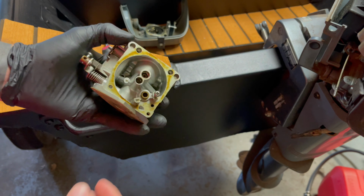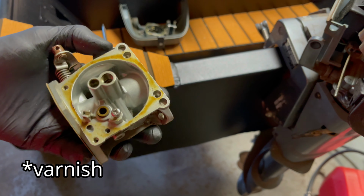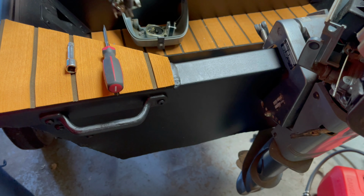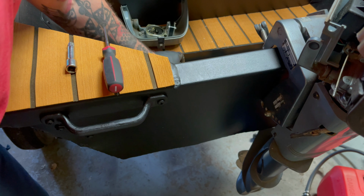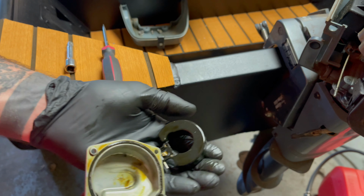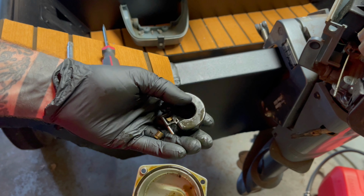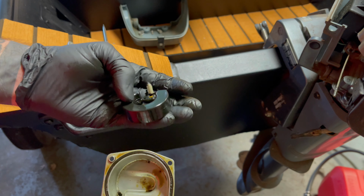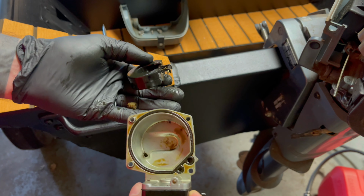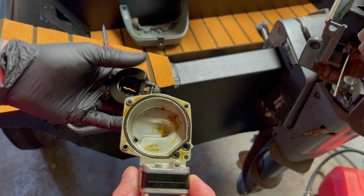I went ahead and just pulled the whole carb off. It's actually pretty clean. It's got some tarnish around here, but everything on the inside looks good. Gaskets look good. Went ahead and pulled the float out of it and the jet. The jet's clear, but it does have a little bit of tarnish in there. And the float bowl's got a little of that tarnish. Oh, just old gas. So I'm gonna go ahead and just clean these up with some carburetor cleaner and put it all back together. And I think we should be pretty much good to go other than cleaning that gas